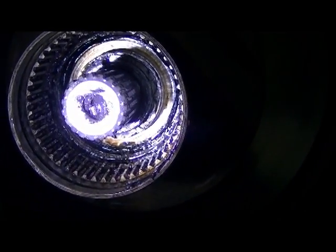We have the bearing adjusting nut in there. That's what I call it. I don't know what it's officially called. I've heard the spindle nut or whatever, but that particular nut is not adjusted very tight. Matter of fact, once you get into the kit, you'll see 30 to 40 foot-pounds torque down, then they want you to back it off. You don't want that tight, but then again, you don't want it too loose. You don't want any vibration or mechanical play. That's kind of a trick getting that adjusted just right. Not too tight, not too loose, right there in the middle.